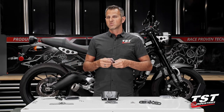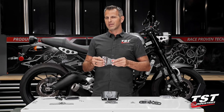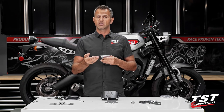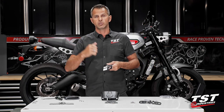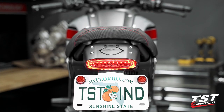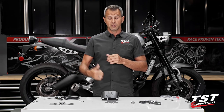Typically some people choose to wire in resistors to increase the current drawn by their signaling system to fool the OEM relay into thinking everything's cool. We don't like resistors around here — we do sell them because some people have determined that this is the industry standard, but we have a different standard. We have a replacement LED flasher relay that replaces your OEM unit under the seat. It's very easy to get to — a two minute job. You take the seat off, put this in, and you're good to go. This restores the flash rate to 85 cycles per minute. If you don't like that flash rate, we do have a video showing you how to install this and configure the flash rate if you'd like to change it. Choice is freedom and we like to pass the freedom to you.